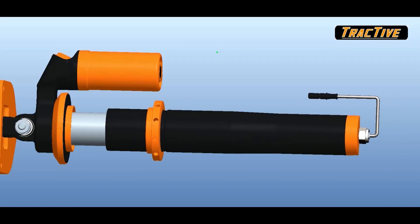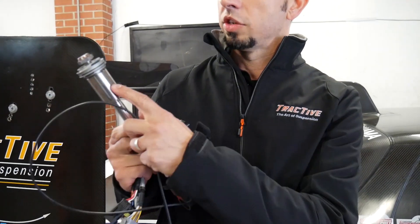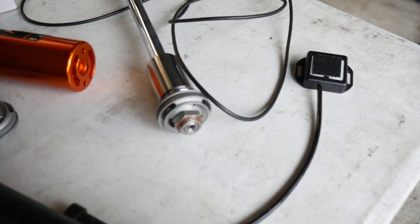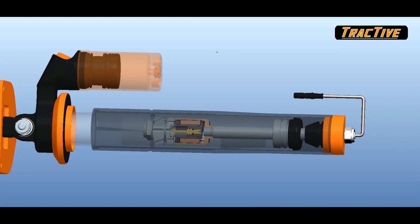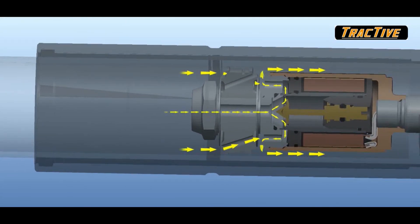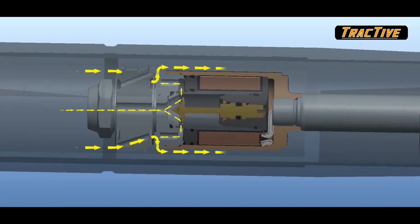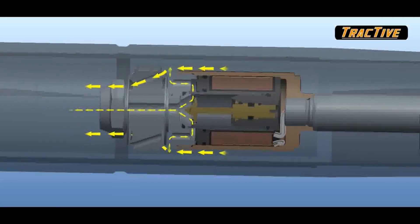Could you give us a quick run through of how the mechanism in this damper actually works? They work in principle like a normal gas damper — they have oil inside, a piston, shim stack, etc. What's different is they have a magnetic solenoid in part of the assembly. Inside the solenoid moves and opens and closes the valve which controls the oil flow through the piston and through the rod. So if you were to have, for example, a one-way adjustable damper, you would be doing the manual version of that, but these are electronically controlled.